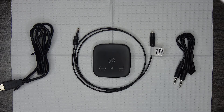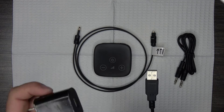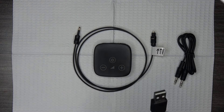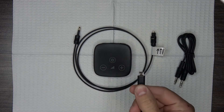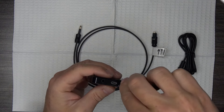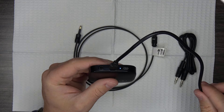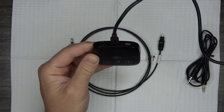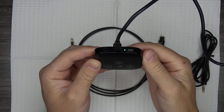To start the setup process, begin by plugging in the TV connector's power supply using the USB cable. Plug the larger end of the USB into the wall adapter for use with an electrical outlet. If your TV has a USB port on the back, you can plug the larger end into that port instead. Next, plug the smaller end of the USB cable into the slot in the middle of the back of the TV connector, which is also the slot closest to the button with the chain link symbol on it. The TV connector should now turn on automatically, and you should see a green indicator light turn on, then turn white, indicating that the TV connector is in standby mode and not transmitting any audio. If it does not turn on automatically, press the power button on top, and you should see a green light followed by a solid white light.